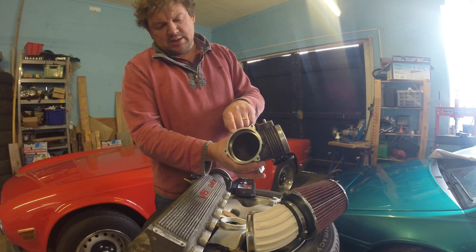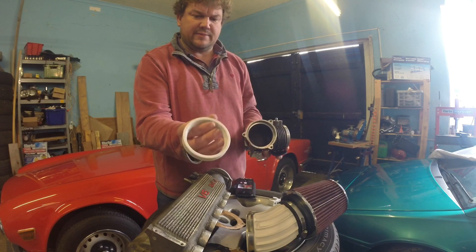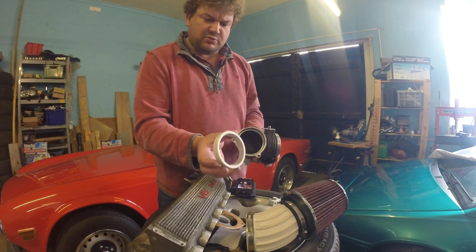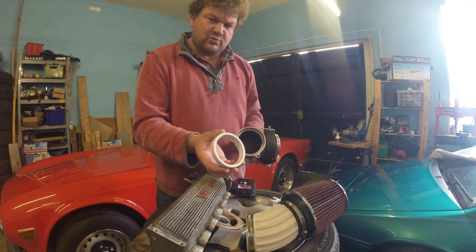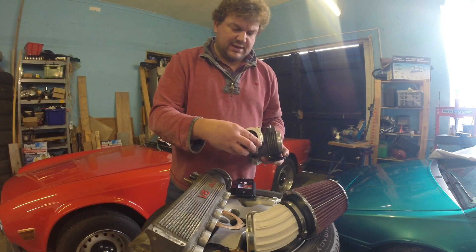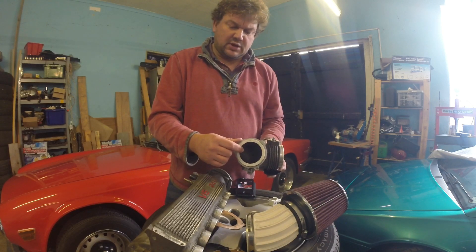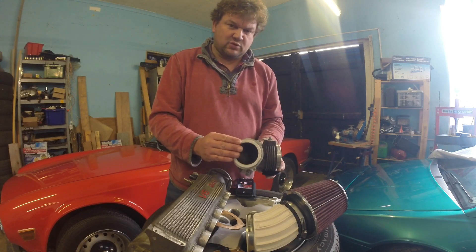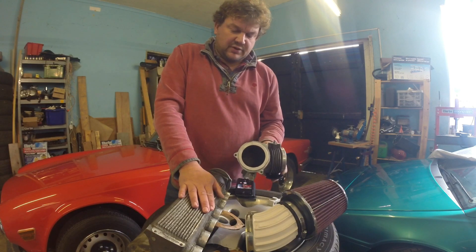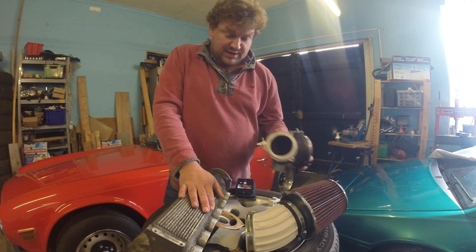Still with the nanodiamond material — there's a step here where it steps down to go into the throttle, so I've made a nice angled ring to step it down. The heat deflection temperature of the material normally is 107 degrees centigrade, but if you anneal it in an oven it goes to 125. That's what I've done. It's not under any load, but it does need to hold its shape. That's quite a challenging application because when you shut the engine off, the temperature in the whole engine compartment goes up, including anything bolted to the engine.